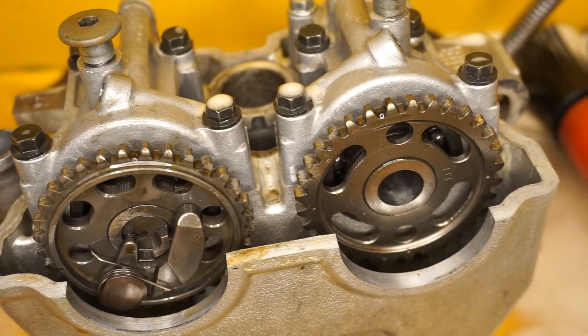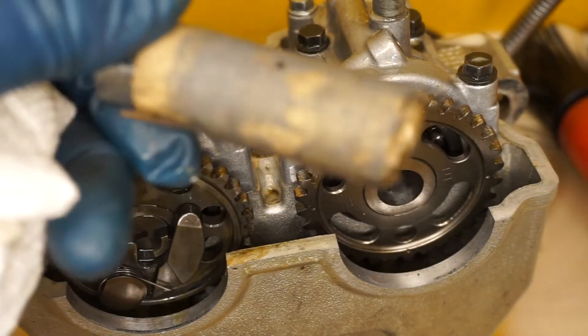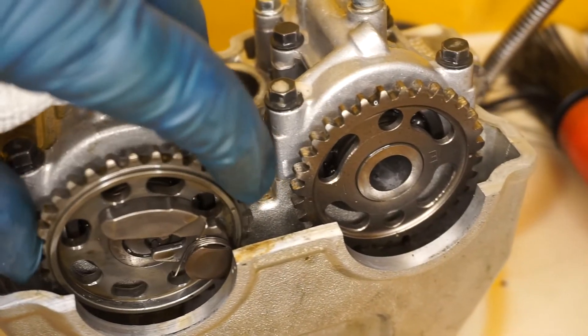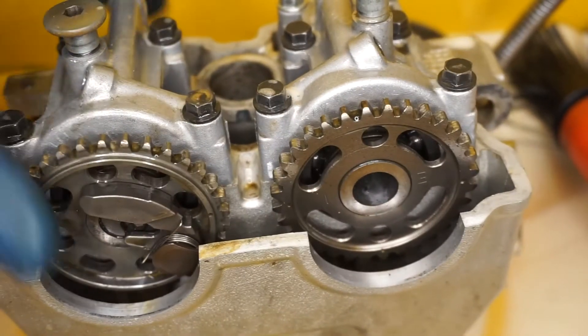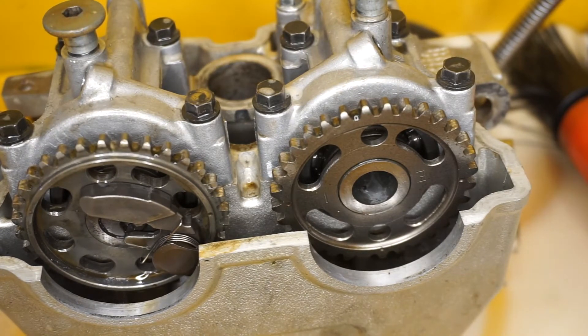Now the top of the head — I built me a little hone here, and what I used for that is a 5/8 spark plug socket. It did one and a quarter wraps of 220 paper. The exhaust valve is still not turning easily — intake's nice and smooth, it doesn't have any play in it. But this one over here, you're not turning it with your bare hand. Even when I put a little oil on it, it still doesn't want to turn. So we've got that to do yet.